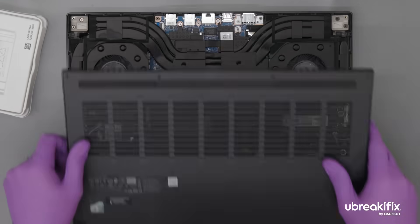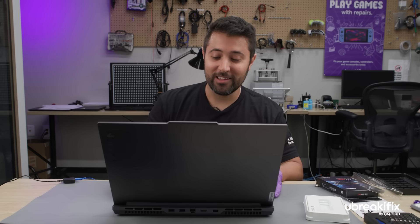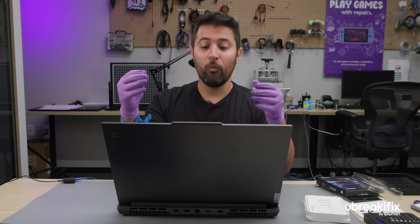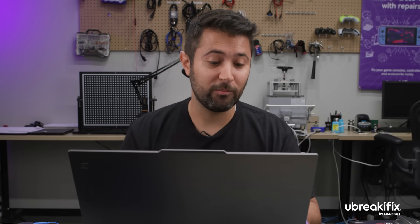What's the most difficult part about doing this type of repair? The hardest part for this repair is sometimes knowing how to get into the BIOS. The reason we need to get into the BIOS is we need to tell the computer what hard drive to look for. Since we just put a new hard drive in, we have to tell the computer what to do.